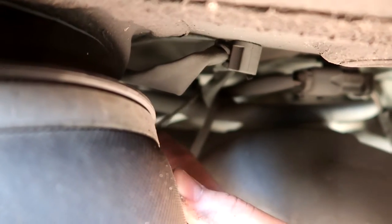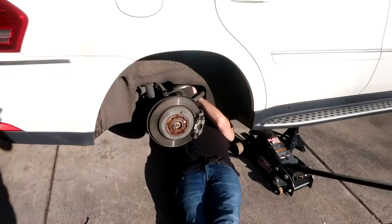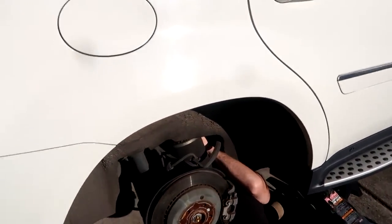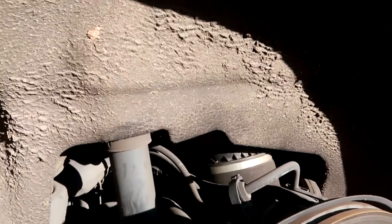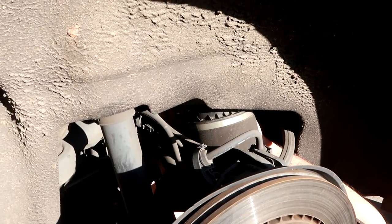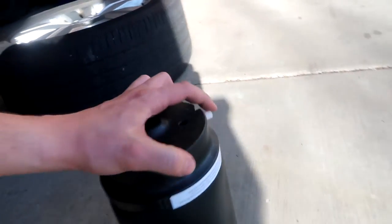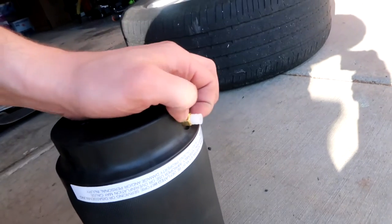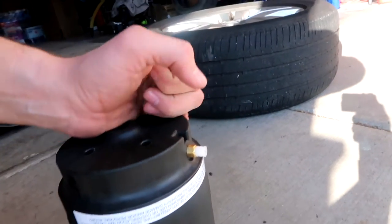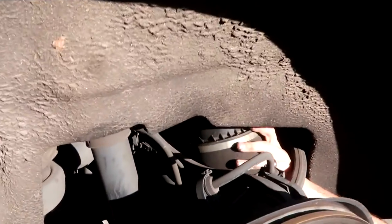There's not a lot of space in here, so it'll be very difficult to show you. Basically what I'm going to do is reach my hand up back here and feel with my fingers the little nut that holds the air hose — that's a 10 millimeter. Andre stepped in to help since there's not a lot of room; he is positioned very awkwardly and I bet very uncomfortably. The goal is to get that airline out. We got the hose out — Andre disconnected it.